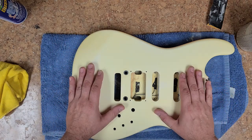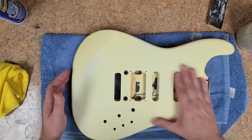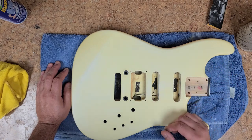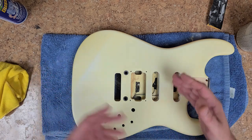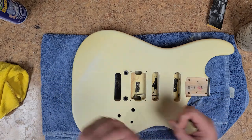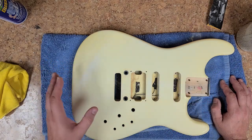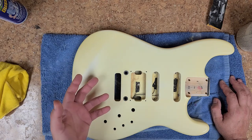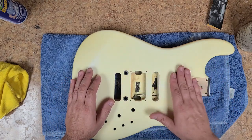This is a 1980s body. I spoke with the owner about what he wanted me to keep as far as the way this looks. This originally was a pearl white, but through age it ended up changing in color. It has like a yellow tint to it — a patina — and he wants to keep that yellow tint. So I tried my best to keep it, and instead of using a 600-grit sandpaper, I went with an 800-grit sandpaper to not cut as much or as fast.